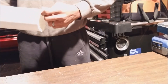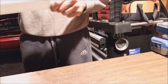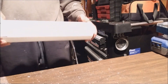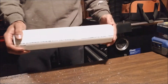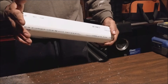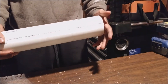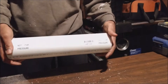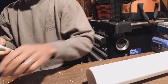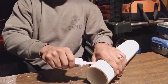I want to point out that PVC is not rated for pressure, but this application is not a high-pressure situation. The overflow tank on a Mustang and many other cars doesn't hold pressure. There are cars that have overflow tanks that do hold pressure — you don't want to do this for a pressurized tank. You can open this overflow tank whether the car is hot or cold, but don't ever do this on a car that has a pressurized overflow tank.